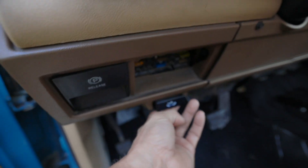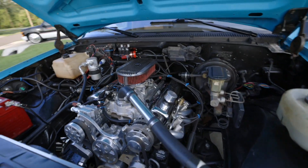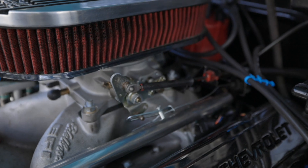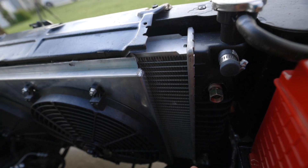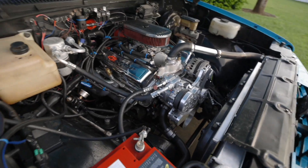Now we've got to go under the hood. Remember how the truck was driving real sluggish on the test drive? I hooked my peepers on the old TV cable — that's an issue. Also during the under-hood inspection I found some bolts for the intake manifold that are not even remotely close to being tight. And these are the ports for the transmission cooler lines in the radiator, so I think we're going to have those hooked up too.